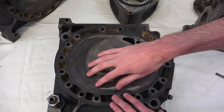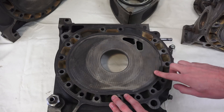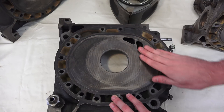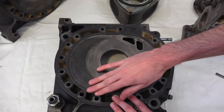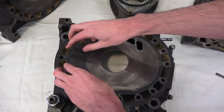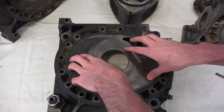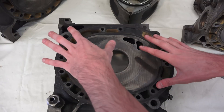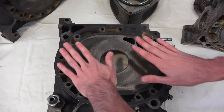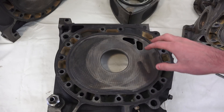The challenge occurs because, as you can see, combustion is going to be occurring constantly on one side — that's why this area is darker and this area is lighter. This is where intake is always occurring, this is where combustion is always occurring. Because of that, you're going to have a huge temperature differential where this side is going to be much hotter than the other side. So you're trying to maintain a seal, but the temperature is different, and the metal expands in different ways on different sides of this housing, making it very difficult to create a good seal.